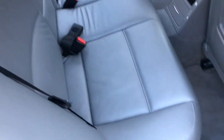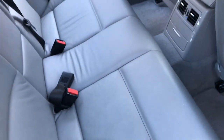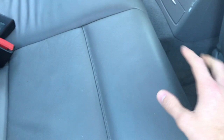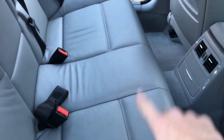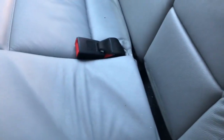First things first, we're going to remove the bottom bench. I won't be able to show you on camera but I'll explain it first. You pull up on the seats here — there should be some clips, no screws, for this bottom bench — and it should slide out. Feed the belts through. It's just a matter of pulling quite hard up here, here, and here, then pulling backwards toward the front of the car to slide it out, then slide it over the belts.